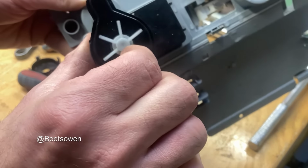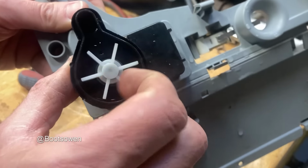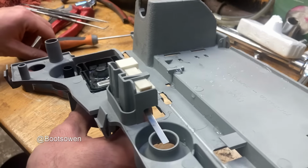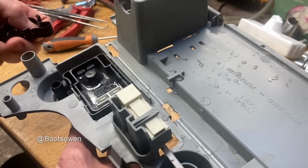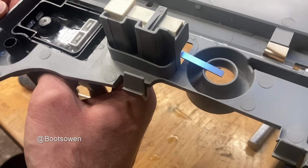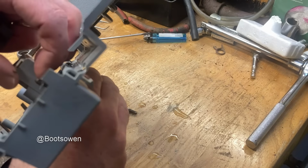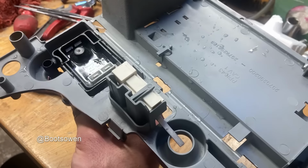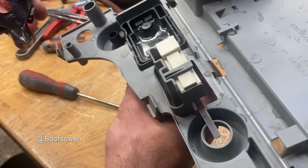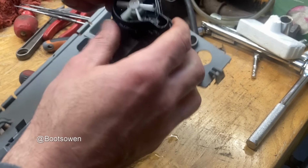The pump is turning. It's not one with the rubber ends, so that is not the answer. It's not full of crap either, there's a bit of fluff there, but that's not the problem. So it could be the pump. I could also disarm the float switch so it'll just leak. I could also drill a hole in the bottom of it and have it draining out onto the floor if I was running it outside. Right, there's nothing visibly wrong with that pump.